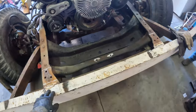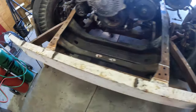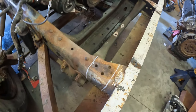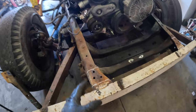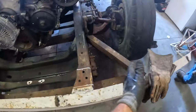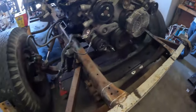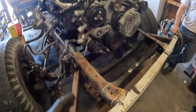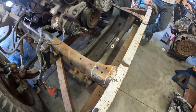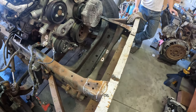So we marked out exactly where we're going to cut the frame. We're actually going to keep the bumper on and use all the support there — essentially we're just going to cut out the frame here to here. The coolant system is pretty wide, it comes out to about here, so Kyle suggested boxing it out and reinforcing all of it back into the bumper. We also need to have some support coming up for the coolant system, so we're going to cut this out, leave the bumper, and hopefully have adequate amount of space for the coolant system.